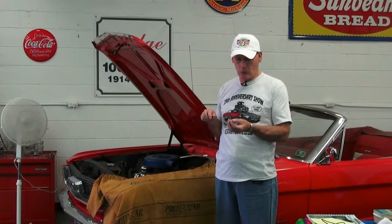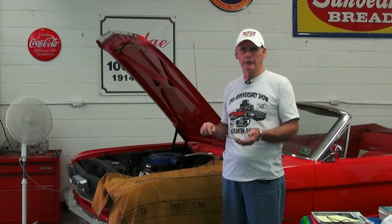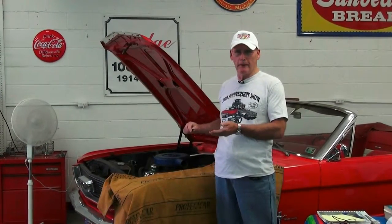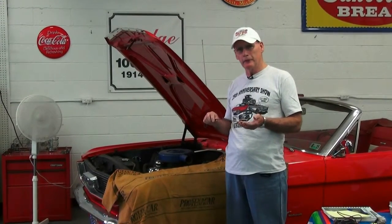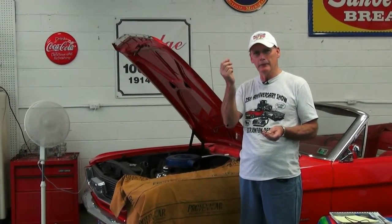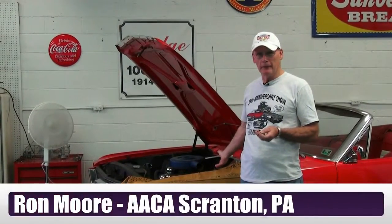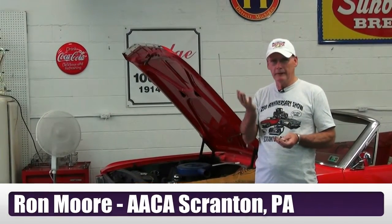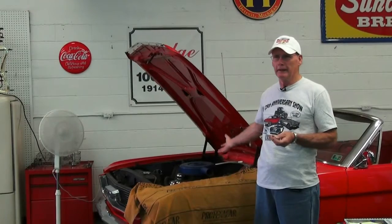Another indication if the oil was overfull is I would be concerned there may be a little bit of water-antifreeze mixture in the bottom of the oil pan. Water and antifreeze mixture is heavier than oil and will settle on the bottom of the pan. So if the level was extremely high — either someone overfilled it, or we may have some water in there — I would jack the car up and very slowly take out the drain plug and see what comes out first. If there's any water, green antifreeze, or water in the bottom of that oil pan, it's going to come out first, which would indicate an internal crack in the block, cylinder head, or a head gasket.